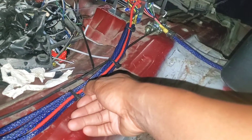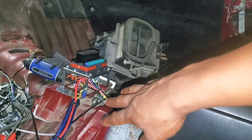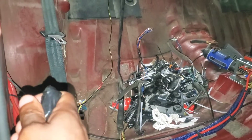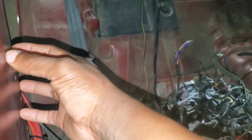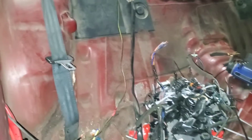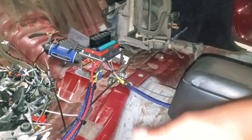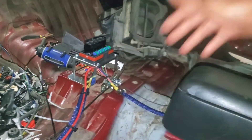With the fact that this battery wire is constantly powered by design of the fuse box for a universal application, the relay will always be on if I connect it up to the ECU. I'm going to fix this in the future by connecting a big relay to this main point where all the battery is. I'm going to mount a circuit breaker and an 80 amp relay — it'll come off the battery, into the circuit breaker as the fuse, then into the 80 amp relay which will be activated by ignition. That will power this box, and then I can wire the input up to the fuel pump output for the ECU so the fuel pump can be duty cycled again. But for the time being I don't have that circuit breaker or 80 amp relay, so I'm going to leave it to the switch for now.